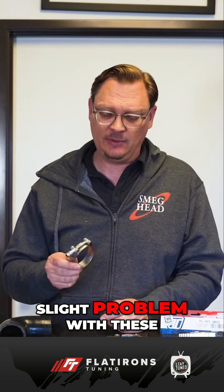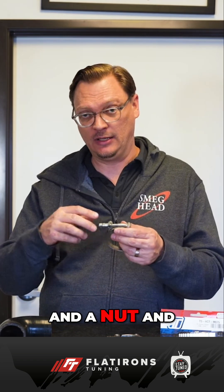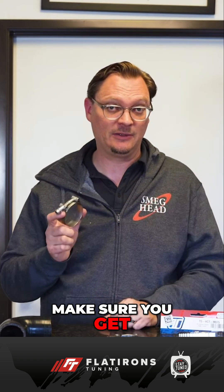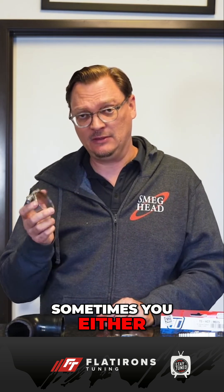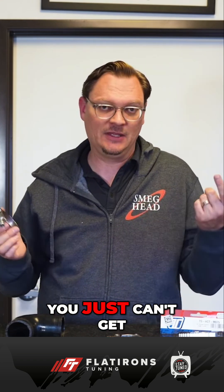The other slight problem is that because it's basically a bolt and a nut that's threaded, the range of adjustment on these is not very good. There are a lot of different sizes and you've got to do the measurements to make sure you get the right size. If you're even just a little bit off — like you don't account for the thickness of the hose when doing the measurement — sometimes you either can't get the T-bar clamp over the hose or you just can't get it tight.